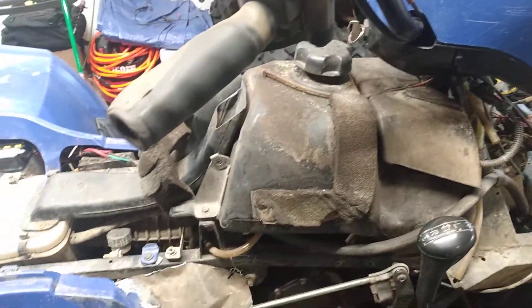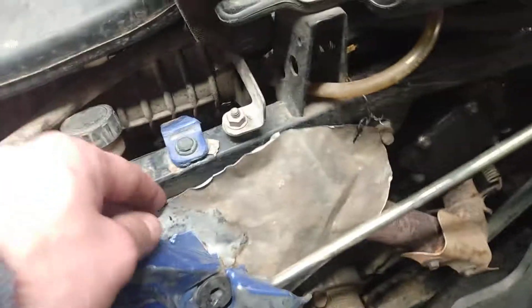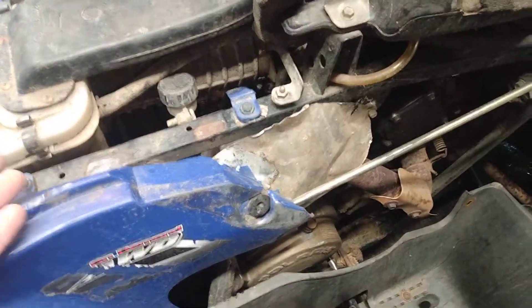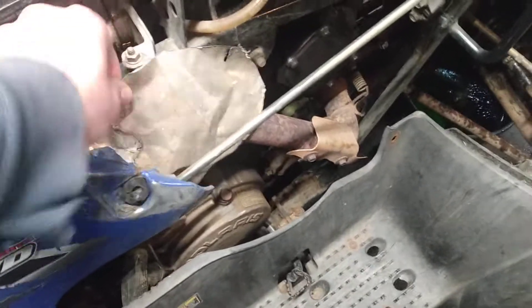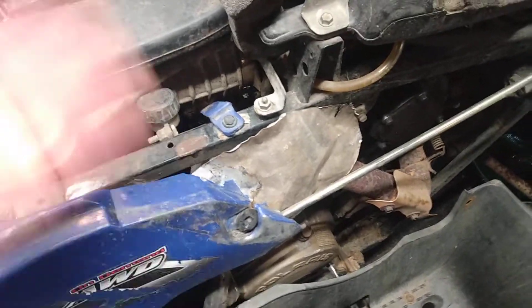The first thing I always check with these older Polarises — and even the newer Polarises — is this wiring. Yeah, it's all melted. I cut it back a little ways, but it was just all melted inside. And you can see, instead of fixing it the right way — which is to use heat tape, because that's what you're supposed to do when you have a heat problem — you can either wrap the exhaust or use chrome heat tape on the inside of the plastic. I've done that on mine and it doesn't melt the plastic. But this person decided to use a piece of tin instead. That doesn't actually do anything for metal; the heat just goes right through it and starts melting the plastic. So I'm going to wrap it in heat tape.